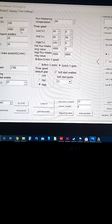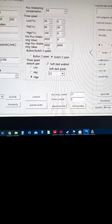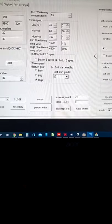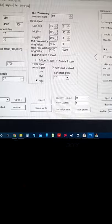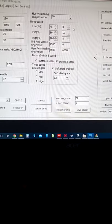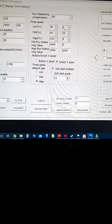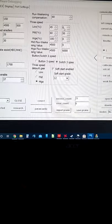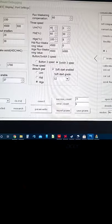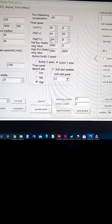I pretty much just took that and matched it with over here. So I put 1,300, 350, and then 1,300, 350, and I've got 1,300 here, and then 10. Alright, your 3-speed. They've actually got in the manual that this is low, and this is high for your range. So your percentage range should actually be 45 to, say, 35. 10% margin, or actually 45 here and 35 there, but I didn't see much difference in changing it, so I just made all these zero and went by this.